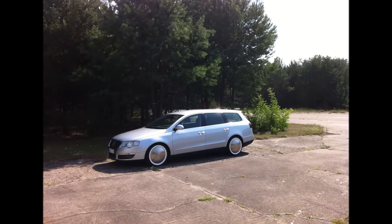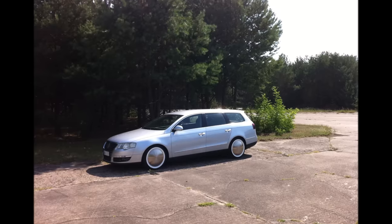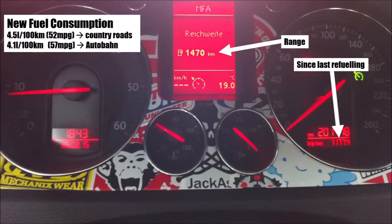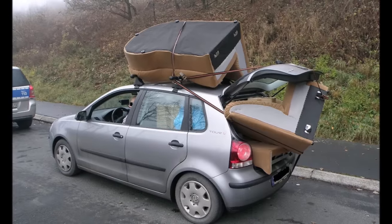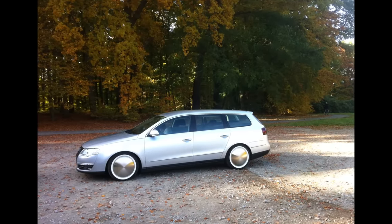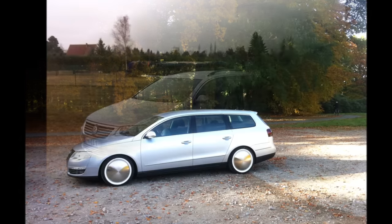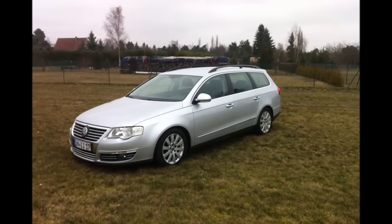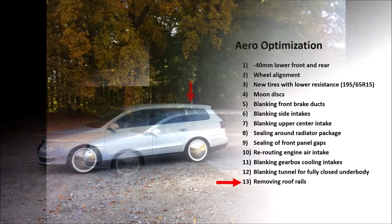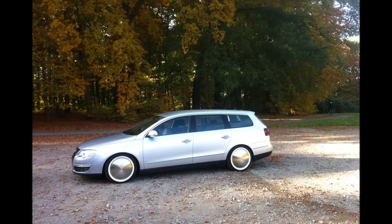I had changed a lot of the car's aerodynamic setup, but apart from it being lower and having moon discs, you couldn't really see most of it — and that was exactly what I wanted. The result of the changes was that the car now needed 4.5L/100km — or 52 MPG — on my daily trips on country roads, and only 4.1L/100km on my long journeys on the Autobahn. Of course, manufacturers always have to consider every extreme thing a customer could do under every ambient condition, but by adapting the car to my specific use case, I could turn it into a much more efficient vehicle for me. Later on, I removed all the aeromods and changed it back to its original setup before selling the car. I pushed the plates through the roof, installed the roof rails again, and you couldn't tell they had ever been removed. I hope you liked this little story about one of my daily cars — see you at the next video.